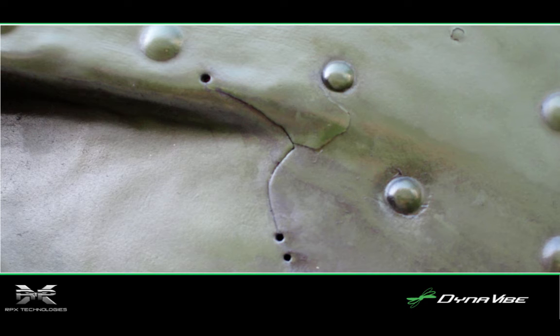As we were setting up the photo tach on the AN-2, we observed these fatigue cracks, showing evidence of excessive vibration, and the reason why it's important to dynamically balance the propeller assembly.